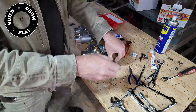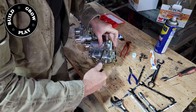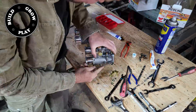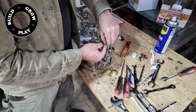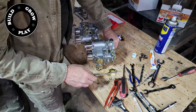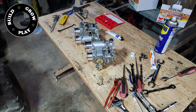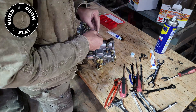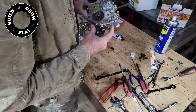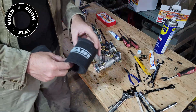The only thing to do now is to set up the linkage takeoff for the Webers. The Weber comes with the linkage set on one side, and it was obviously the opposite side that I needed. So I simply swapped everything out to the spec that I needed, making sure not to over-torque nuts and to replace everything as it came off.